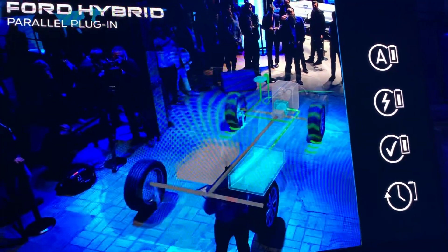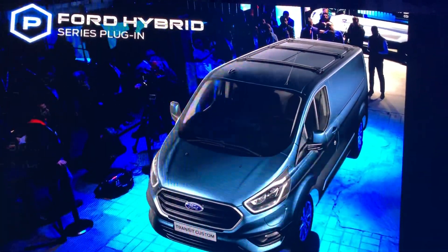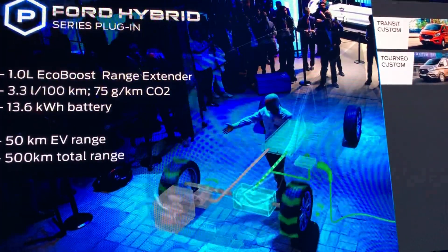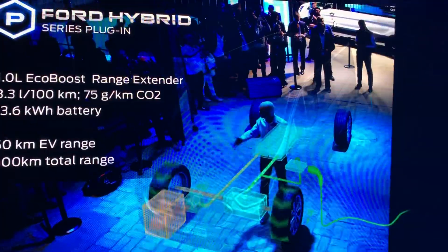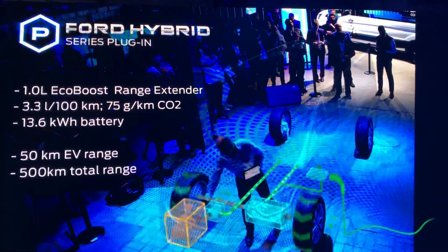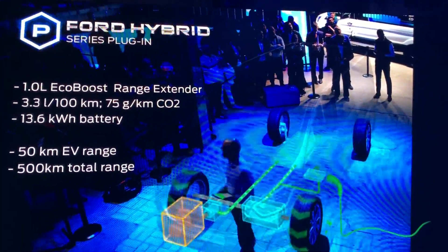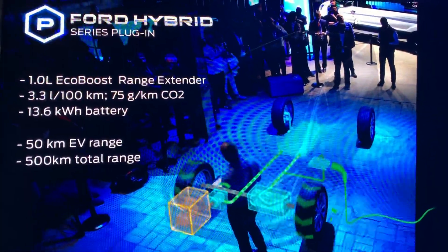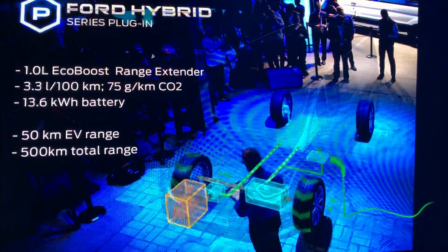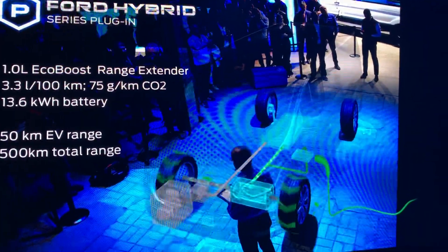So, next step in the ladder — in the one-tonne van and large people-carrier segment, Ford is the first manufacturer to offer plug-in hybrid technology. This PHEV version uses a so-called series hybrid architecture. The front wheels are driven electrically by this motor, and there's no mechanical connection between the combustion engine at the front and the wheels. The combustion engine kicks in to drive a generator — a second electric machine — which then recharges the battery if and when needed. And regenerative charging again pushes energy from the wheels back to the battery, enhancing range. So you get 50 kilometers of electric range and a target overall range of more than 500 kilometers or 310 miles.